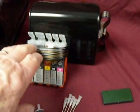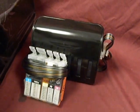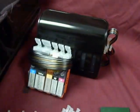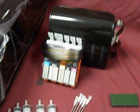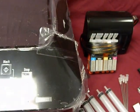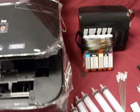This is our newest system. It comes with our double loop hose bracket. On the newer printers, even like Epson, the print heads aren't strong enough to draw the ink, so by eliminating the backflow dampers and designing something like this, it's worked perfect — you get good ink draw to the print head. Now I'm going to turn the printer on and then remove the cartridges to show you how to install our continuous ink system.